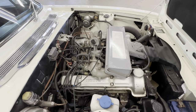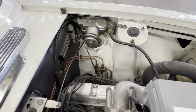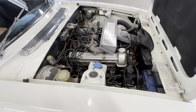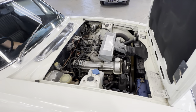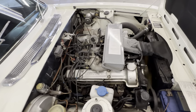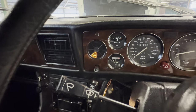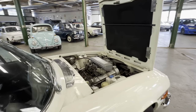Into the engine bay now. It's your Triumph V8, a 3-litre twin-carb — four-speed manual with the overdrive. We'll do the strut tops and inner wings. James fires it up here with a little bit of choke, being cold. No hesitation whatsoever off that — it wasn't even a full revolution before firing up. Taking the choke down a little bit and it should tick over nicely. Ticking over lovely and smooth — there's no wobble at all from those engine mounts, lovely and happy. We've got an oil pressure gauge in this one; choke still on a little bit and there's the oil pressure gauge bang on, straight up. No problems at all with that.